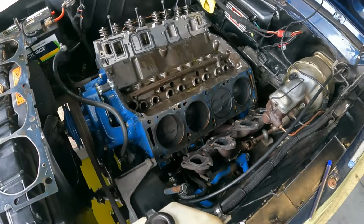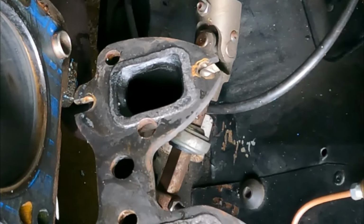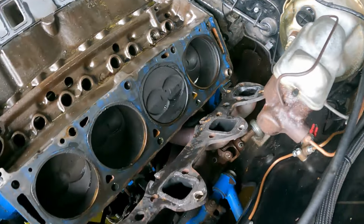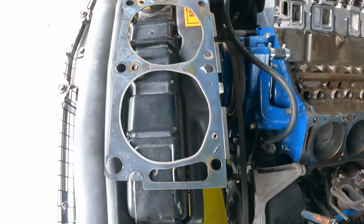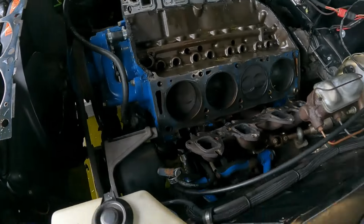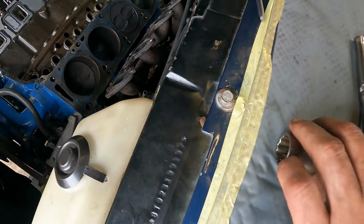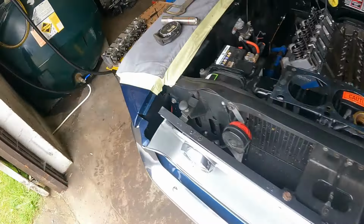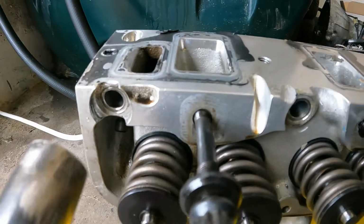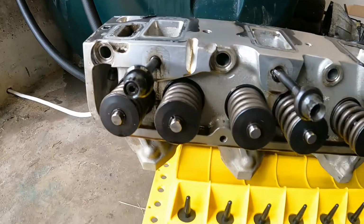Deeper, it's a cylinder head off. I don't know if you can see, but down number 8, it's really tarry, so that is where the oil was coming down. But all the cylinders look all right. Head gasket all looks perfect. It's still got all the writing on from when it went in. I had to make a little custom tool. The socket had to have a bit of a trim. It's on the cylinder head. I reckon these are supposed to have Allen keys, but to get in there, I had to trim the socket down to be able to get in.